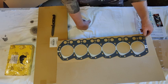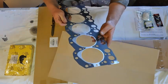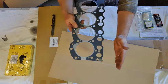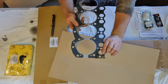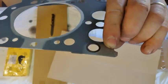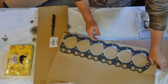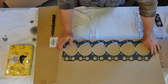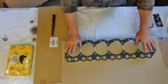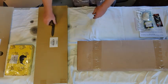And the way you tell which thickness you have is they describe it in terms of notch 1, notch 2, notch 3. And just looking at the front of the car is over here, the passenger side, top of the gasket there'll be a number printed, and if you can see that, it's a 3. This is a notch 3 gasket, so I've probably got a few details wrong about that, but like I've been trying to say to you, I'm an amateur here, but I'm just trying to explain to you what I do know as much as I can. So that's the head gasket.